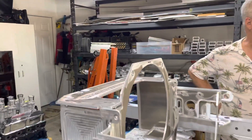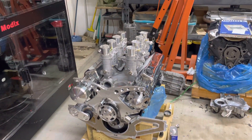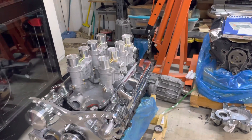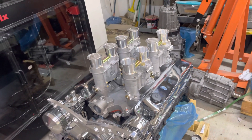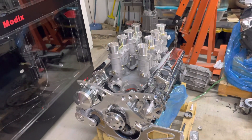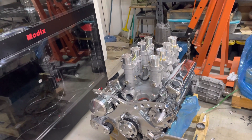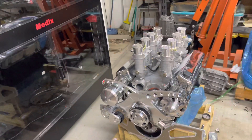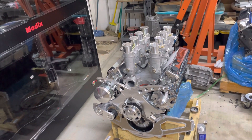While this was going on, I was working on finishing up the first engine. It is assembled with the exception of — I thought I measured really carefully about the bolts that hold the intake manifold on. I went and got the 12 bolts I thought it would take. I come here and I got inch and a half, and they need to be two inches. So every one of them would just get like one or two threads, which obviously isn't enough. I'm going to go tomorrow to the bolt store and get some more bolts. For those of you who don't know, yes, there is such a thing as a bolt store.